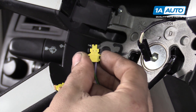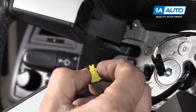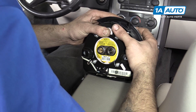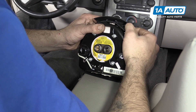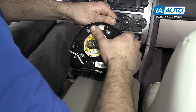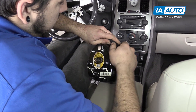Just so you can see what I was doing when removing the airbag connections: there are these two little tabs, one on each side at the three and nine o'clock positions. You just kind of pinch those together and pull back. Don't worry about remembering where these go because they are color coded. To remove the airbag cover, push all the way in until you see these tabs slide out of the openings, at which point you'll lift up on the skirts here and slide them over the tabs.